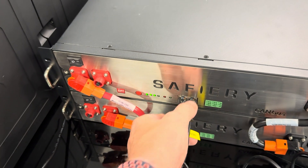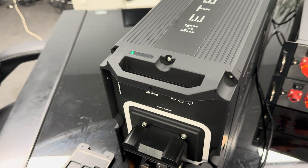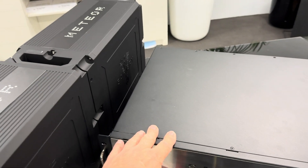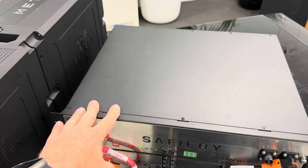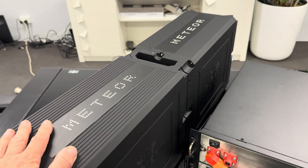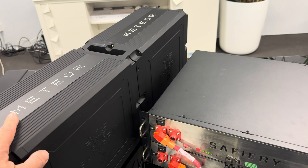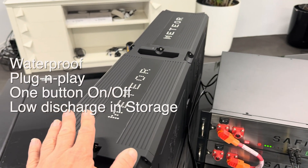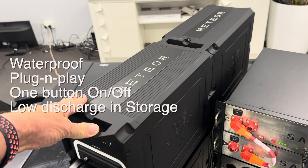On the old battery, making sure the connectors are in the right orientation is critical — if I turn it the other way I'll get a fault on the CAN bus and errors. Here we don't have that; the way it's plugged together it's all built into the plug, so that can't happen. Capacity-wise there's 2400 watt-hours here versus 2355 there. We've got 35 litres here for these two batteries together versus 39 for the other pair — exactly the same weight between both battery sets. This can lie on its side; those can stand upright, but overall this will serve better for the four-wheel drive and caravan market.